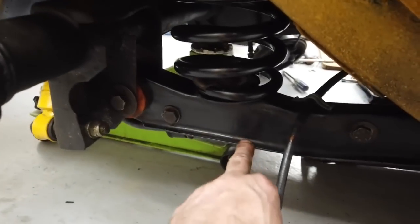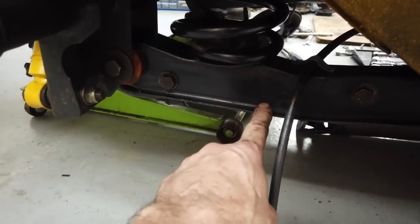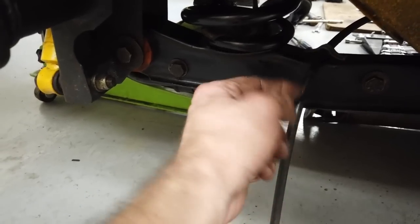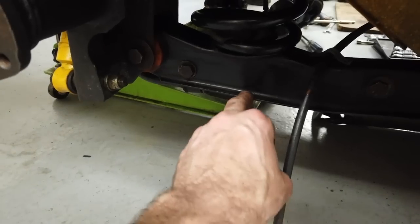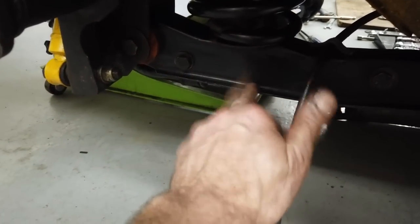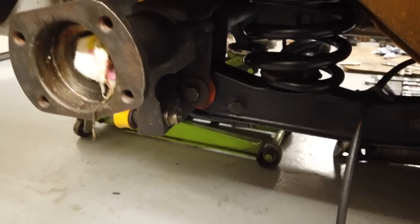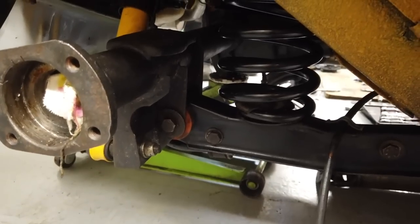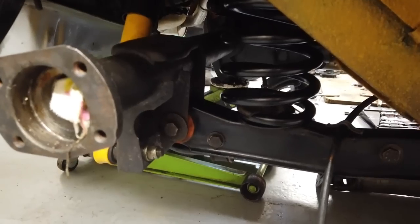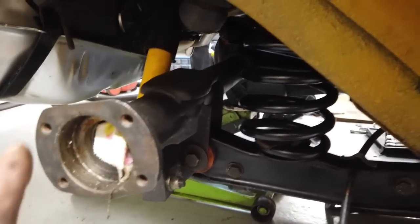So if you wanted to, indeed this one did have this, where it's cut down by a couple of mil and shortened. You can actually shorten these lower arms. You can put a fillet piece in. I did that initially when I was trying to get this right. So we've got on this a slightly shorter lower arm and also an adjustable plate. Don't forget, the reason why I'm working on this is because I've got an A4 gearbox, which created a whole different transmission line geometry and dynamic. The whole thing was slightly different because it's got the Ford Granada A4 gearbox.